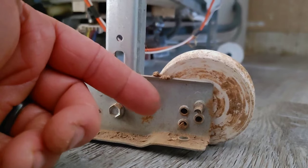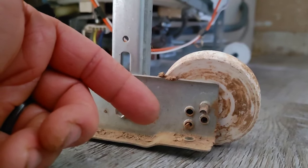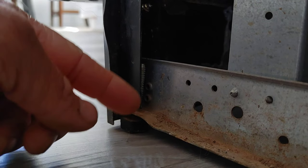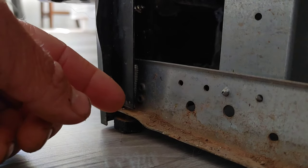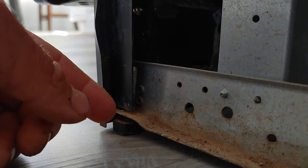In my case, I found out my problem is that the whole thing is leaning too far forward. On the front there are these little adjustable legs that just screw in up and down on both sides — that's how you get the adjustment on the whole dishwasher.